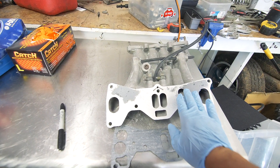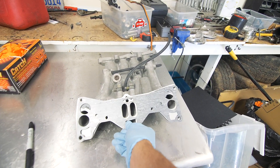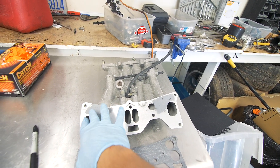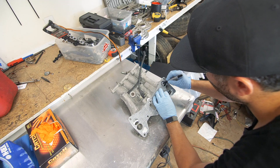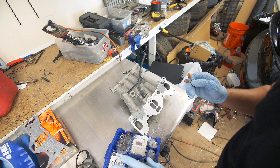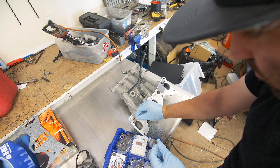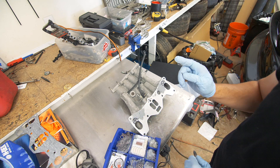I'm pretty happy with how this turned out — the surface seems pretty true. What we'll do now is hold our gasket in place while we trace the outline of our ports, and that will be our guide for when we dremel. Now that we have our outline, we'll basically use our dremel to port out this area, and I think these two attachments should give me enough control to port out a lot and then make a little bevel.